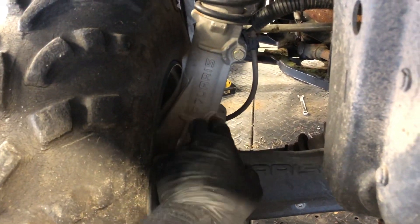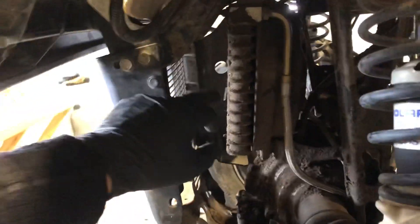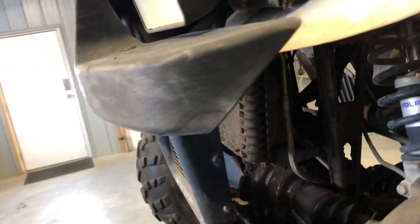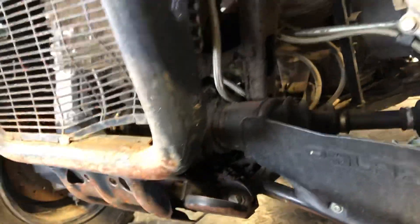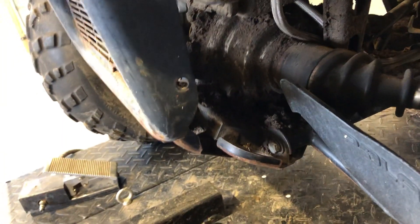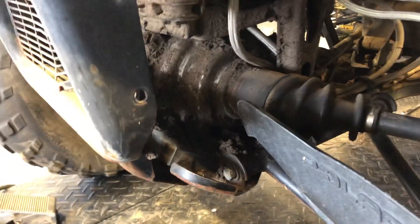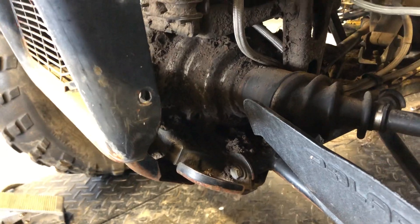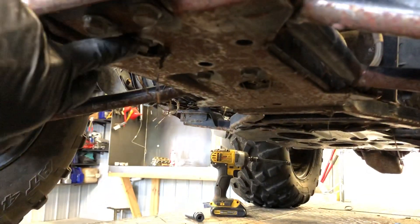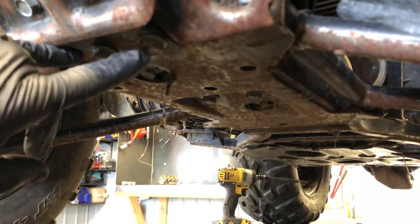Your on-demand four-wheel drive is controlled by this hub — also called a knuckle — and I'll show you that. This is your front strut here with your shock. We've got an oil cooler on this model; make sure it's cleaned out so air can flow through. There's a fan behind there to help cool your motor. We've got your front differential here — it's extremely dirty and will need cleaned before doing any maintenance. The differential has an 11-millimeter drain plug underneath the machine. There are two bolts that hold your front bumper on that look similar to the drain plug.